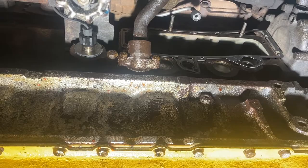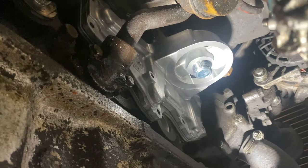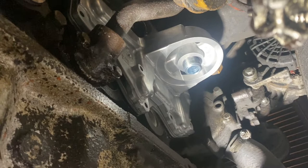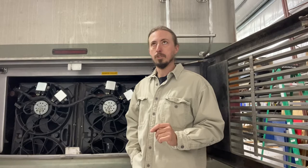Next I'm going to hand-thread all the bolts in first, so I know I'll get a good torque because they'll all be started and I won't have to worry about any misalignment on the gasket. Then it's time to torque. It's all back in — in the name of all that is yellow, I hope this does not leak. About two weeks and two-and-a-half thousand miles later: after I started the engine it was not leaking. I did a little test drive, made sure everything was looking good, and still not leaking. We packed up, hit the road, went through all the four corner states, did about 2,700 miles, and everything worked flawlessly. I crawled under the bus — nothing's leaking. Success.